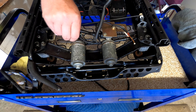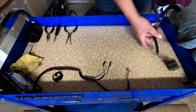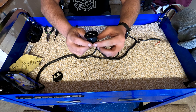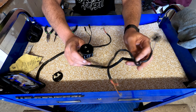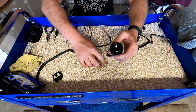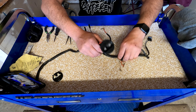To recap: these switches with age fail because the contact makes a little spark and creates carbon buildup on the switch, and it does not make an actual connection. It's that simple to just take it apart, clean it up, and put it back together with a little bit of dielectric grease. Almost every single switch in your vehicle is like that and benefits from this, including door locks. I highly suggest before you spend money on switches, just give it a shot. The worst you could do if you're already planning on buying new ones is break the old one.